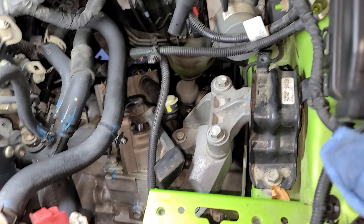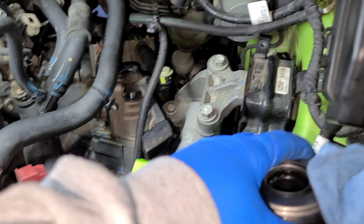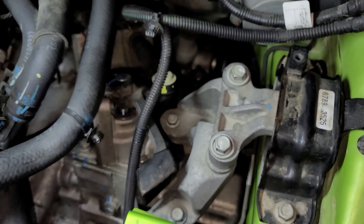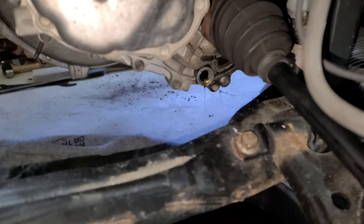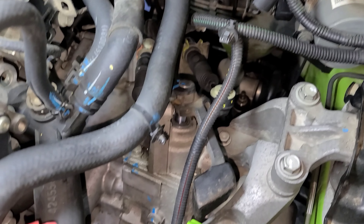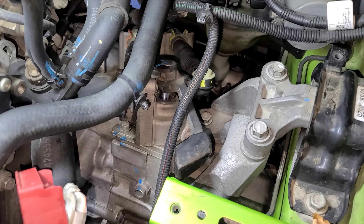We're doing the exact same thing over again. I might take the shift linkage off this time and show that to you. I pulled the battery and the battery box, and now I'm going to pull the mount. I've pulled the axle nuts off, pulled that little panel off, and I have the transmission draining right now — I think it just finished. I'm going to pop both axles off, lower mount, the starter, move this thing over a little bit. All those steps should have been in the first part of the video — stay tuned guys.